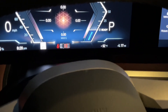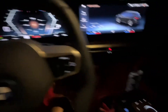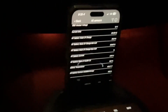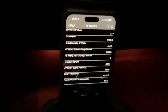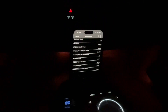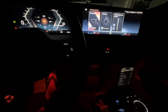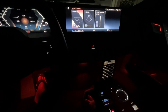Ambient temperature outside right now is 92 degrees — today it got up a little bit over a hundred. I just fired it up and you can see the battery temp right now is 92.2 degrees Fahrenheit. What I want to do is take this down to a charge location, see if there's any 350kW available, and if not use the 150. I want to test the preconditioning feature and see if it makes a difference.